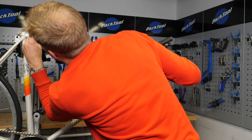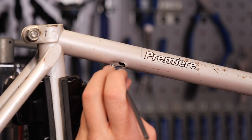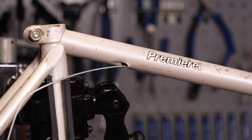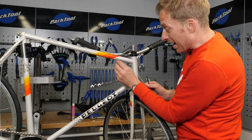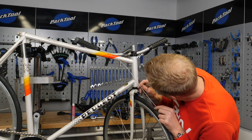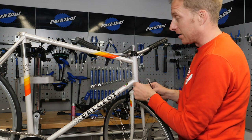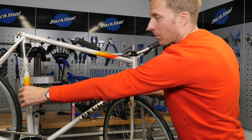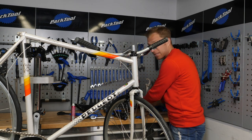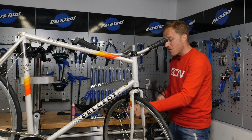Right, I can see it now. Let's try and direct it out. There we are — that is lucky. Now the reason I put through this cable first is that trying to get an outer cable through there will not be the easiest thing, because it is very, very close diameter to that of the outer cable — probably about six millimetres, maybe seven at the very most. So we're going to use this first of all as a guide. With that in place, that's not going to go anywhere — if in doubt, you could easily tape it. Then we can grab some of our trusty outer cable and measure how much we need.